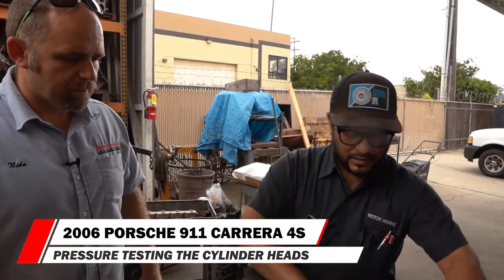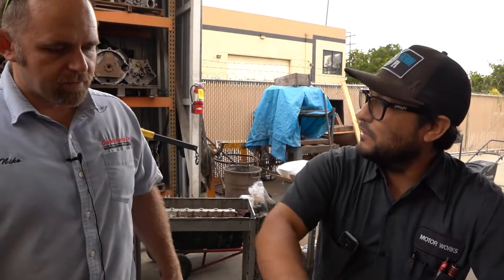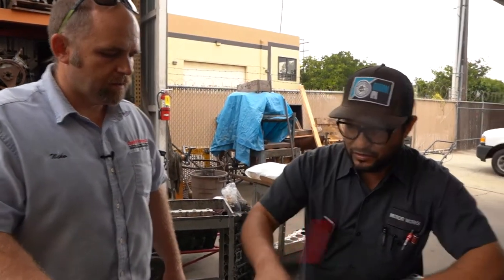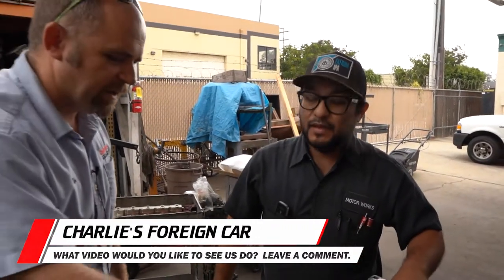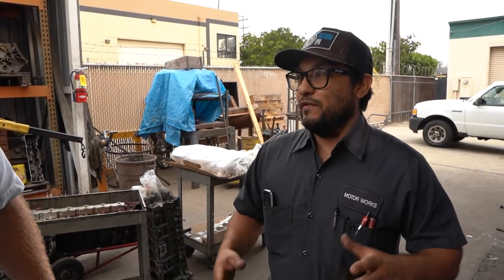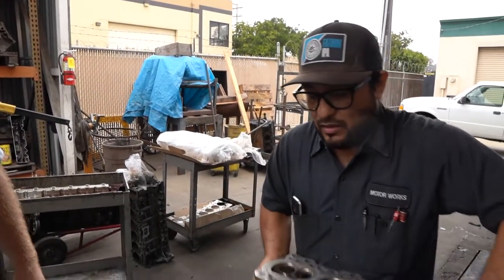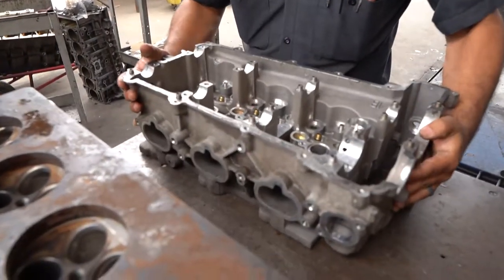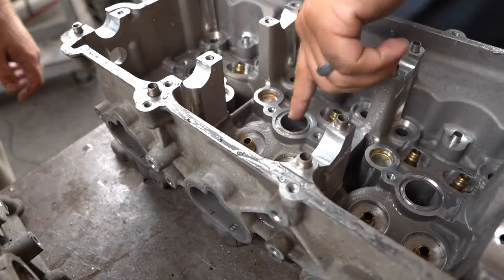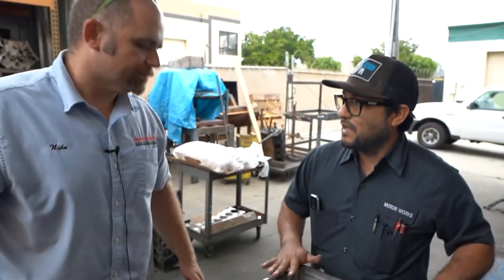Our machine rotates, so we'll see the port side, the top side, the bottom side, and the cylinders are exposed. It doesn't seal the cylinder — it just seals like a gasket, so if something's cracked inside you can still see it. If there's a crack from seat to seat, you'll see it. On these, normally you can't fix it — once you start trying to weld this type of casting, it's very difficult. The most common cracks go from where the spark plug goes towards the valve guide.